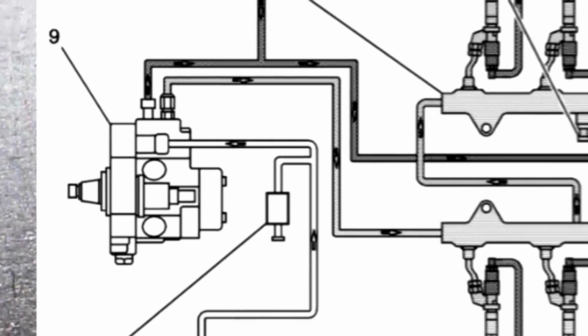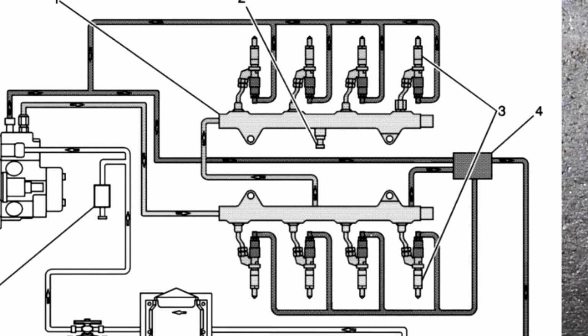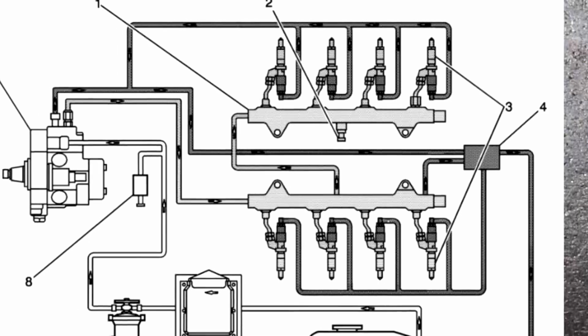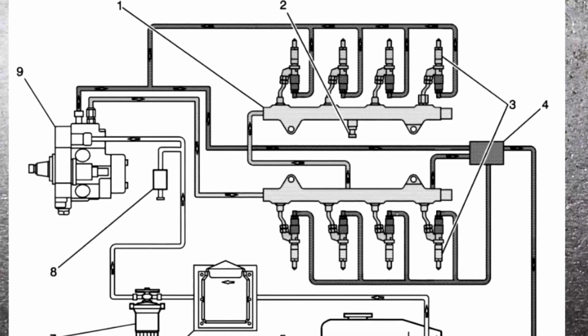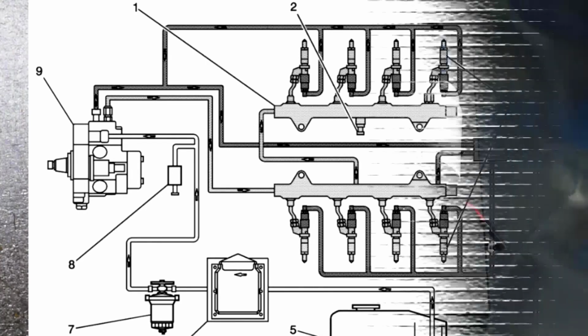And then what I'm doing is I'm taking the low pressure, changing it up to high pressure, coming up through the injector rails. Mind you, 29,000 PSI we can get it injected into the cylinders. Bam, you get your explosion. We use the pump for the timing. Different system.